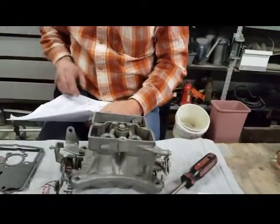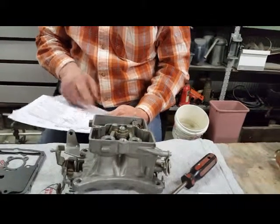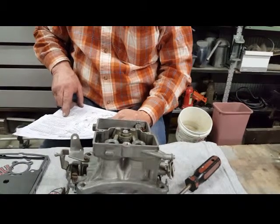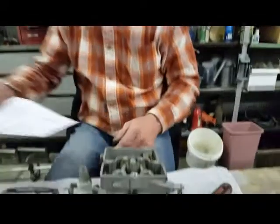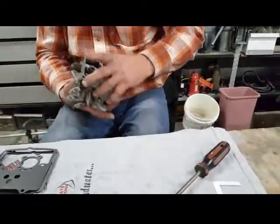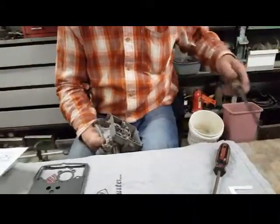I want to see what that ball is called for reference. Number 38 is a weight ball and pump outlet. Number 39 ball is the outlet check valve. Okay. Number 40 is the gasket. That's that metal washer that drops on the top right underneath that flathead screw there, between the two, to stop the tops of those Venturi stacks.